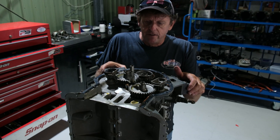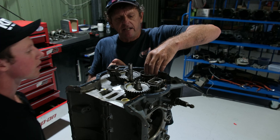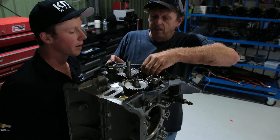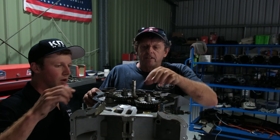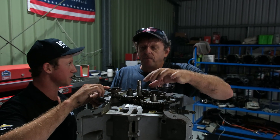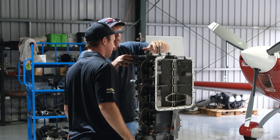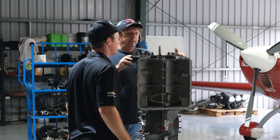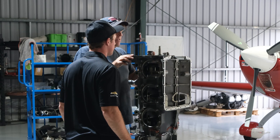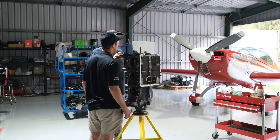As the engine turns, there's the camshaft — that gear is actually part of the camshaft, molded as part of it. This is the crankshaft. That idle gear turns the magnetos and also the cam. The cam spins at half the speed of the crank. So as that crank turns, that gear is part of the crankshaft, and that's part of the camshaft — that's what's happening there.